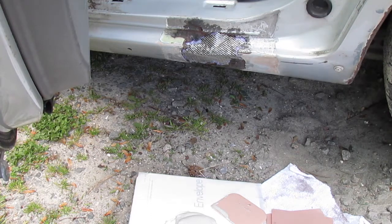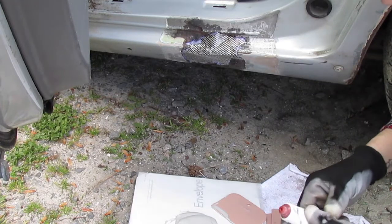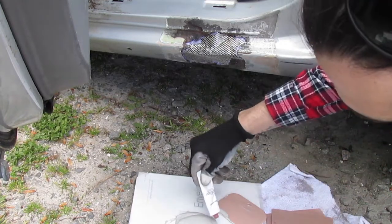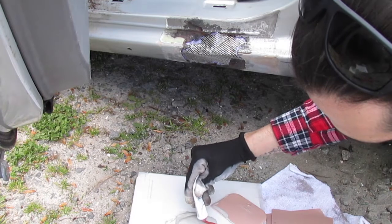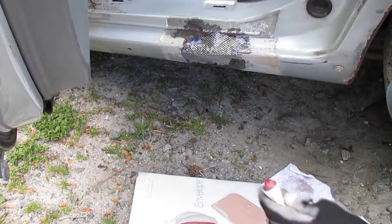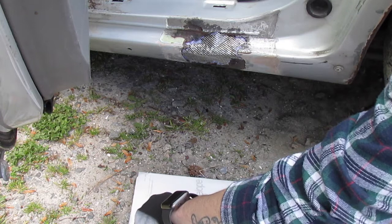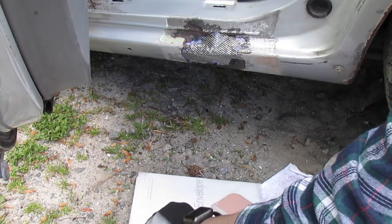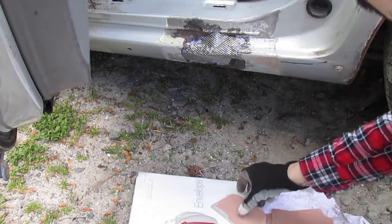If you put it about a half an inch thick, no matter how long you make it or width-wise or any of that, as long as you go about a half an inch thick, then run one line of hardener right across it, if you go from side to side, it's usually a good rule of thumb. It's about like that. Usually a good rule of thumb to be able to see how much hardener you need. Got a little thin line there, so add a little bit extra. That's a good rule of thumb usually to be able to mix it up.